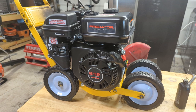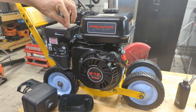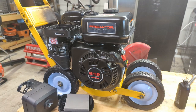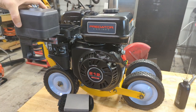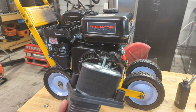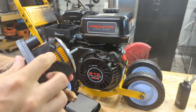It's a couple days later. I mentioned earlier I was not pleased about the air cleaner being just a piece of foam. Kind of chintzy — it's foam, and this is an edger close to the ground that's going to pick up a lot of dust. They make an air cleaner assembly for this that has an actual proper filter. It's not that expensive — I think this whole thing was 15 bucks, and that includes a pleated paper air cleaner element underneath the foam. Proper air filter.